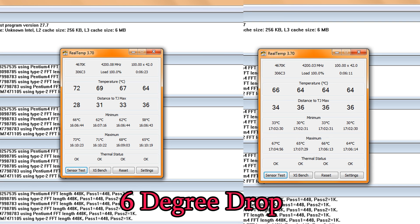On the left here I did a Prime 95 and RealTemp benchmark, and I got 73 max, 71, 68, 65 — that was a six-minute benchmark. On the right I did another quick six-minute benchmark at the same 25 degrees ambient temperature. There was a six-degree difference on cores one and two, and the other cores were similar. The temps are way more even on the de-lidded result after applying Arctic Silver 5.